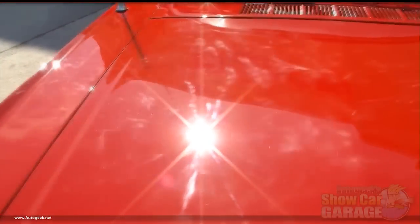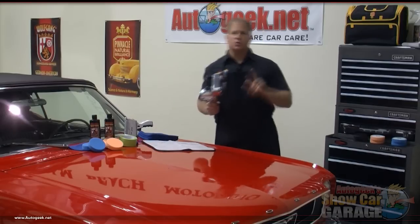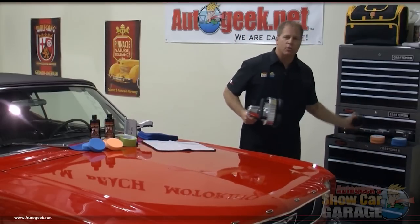Let's go ahead and pull this car back into the garage and I'll show you how to remove these swirls and scratches and restore a show car finish. Before I show you how to remove the swirls, let's take a moment to look at the Cyclo Polisher and how it works. After you remove it from the box, you're going to have to put on these rubber boots that have a hook and loop interface, and these go right on the buffing heads.